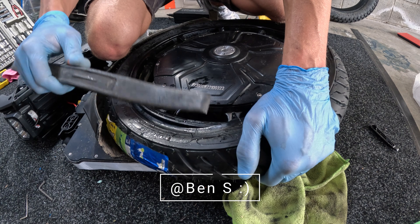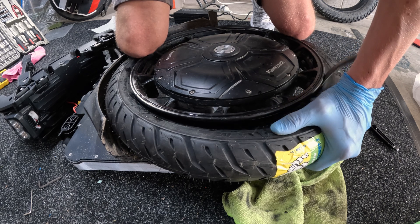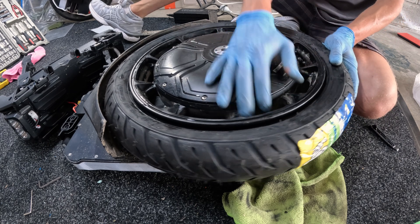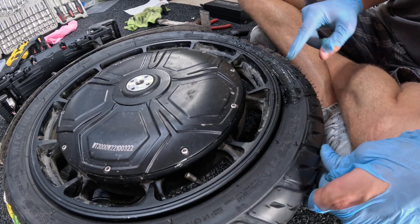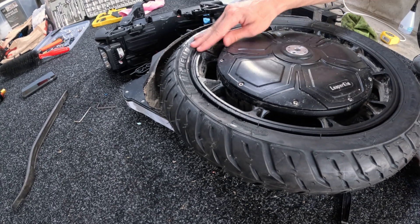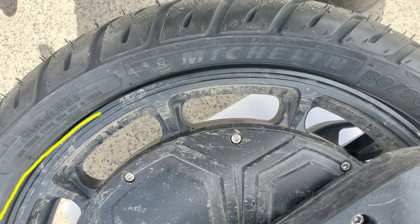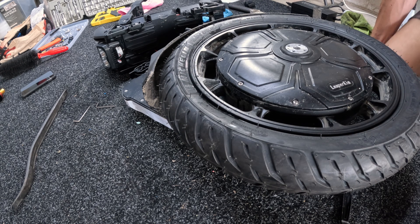Be really careful here not to pinch the tyre. Get the valve centered, pump it up, and leave it for a few hours to make sure we haven't got a flat. I'm having a bit of trouble getting this bit up over the bead, so I deflated, added some soapy water, and I'm going to re-inflate now. The bead line dives down in this spot — it's decreasing — and I don't have a pressure gauge at the moment, so I don't want to go too hard, but it seems to be slowly setting with the dish soap.